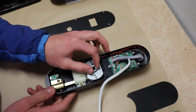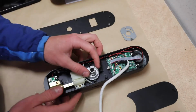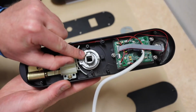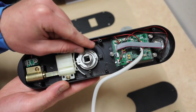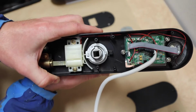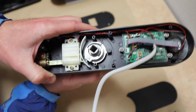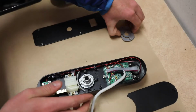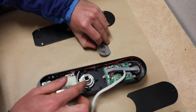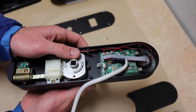Let's take off this faceplate and see if we can get a look at that and determine what's going on. Oh, so that's where our range of motion is being determined, because there's a tab on the outside of this. We can go that way, or we can go this way. Now without that faceplate on guiding my motion, I can actually turn this to the left and to the right, and both have a spring actuated. So in theory, if I wanted to change which way this knob worked, if I would flip this plate over, now I would turn it this way.